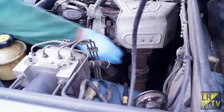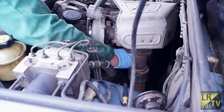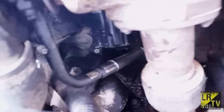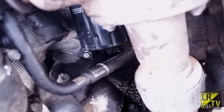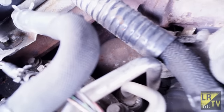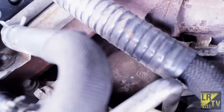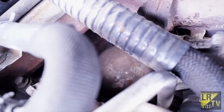Basically, with this tool you can wind it until you've got it off the rubber and then you can wind it off by hand. You'll notice the oil feed pipe just underneath here — this doesn't really allow you access to lift the filter out without spilling the oil. The TD5 has two filters and this one hidden here is a centrifugal filter; we'll approach that in another tutorial.